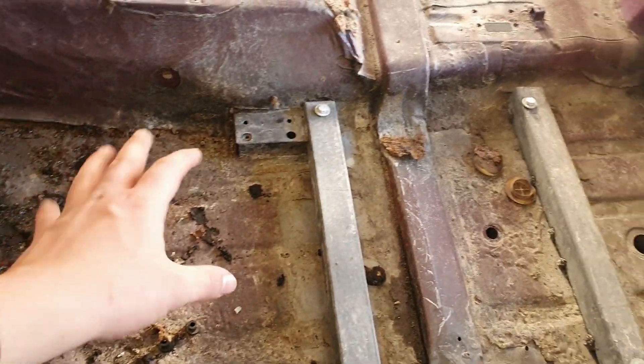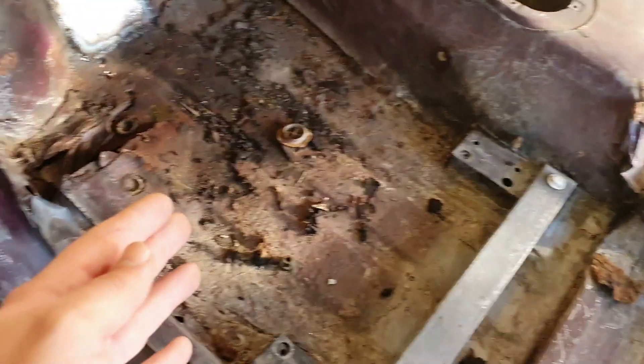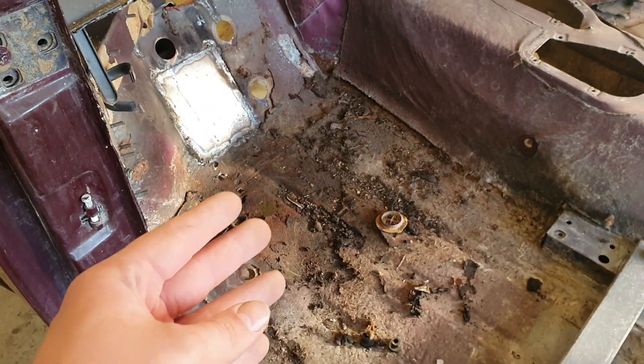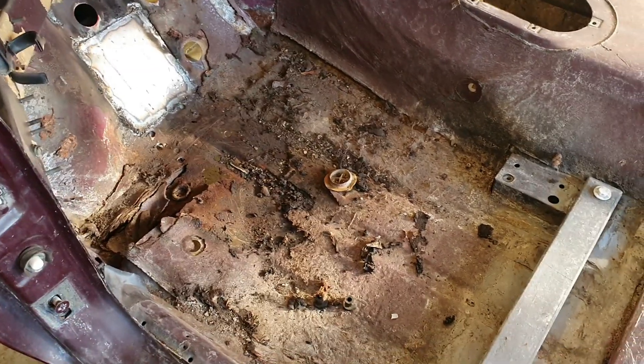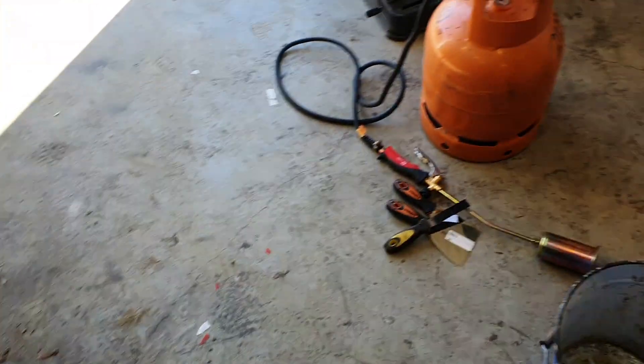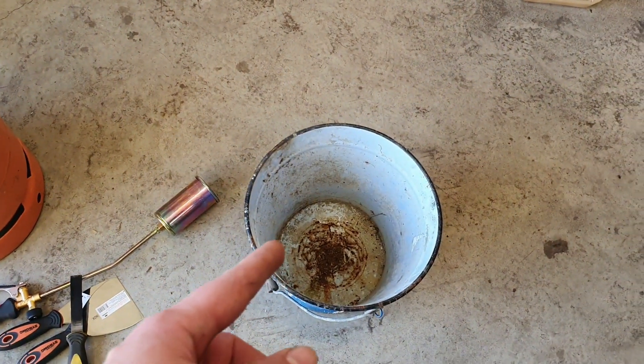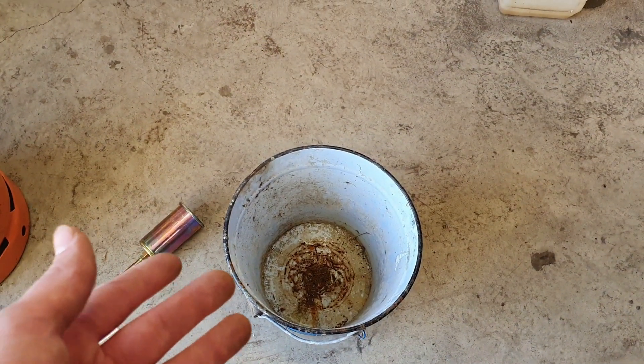So I'm going to use fire to remove all this insulation, because I don't need to think too hard about that — for the chassis cuts I need my head fully in the game. For now I'm a little tired, so I'm doing work that's relatively easy. For this we're going to use a fire breather, a spatula, and a metal bucket — don't use a plastic one, it'll burn through when you put the insulation in, so use a metal one. You can get dry ice to remove insulation but it's really hard to get where I live, so fire it is.